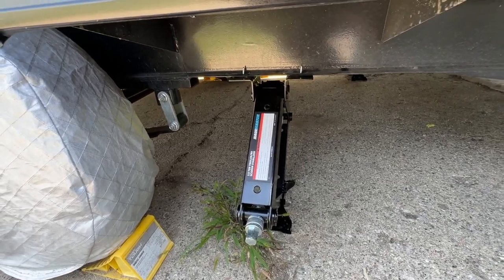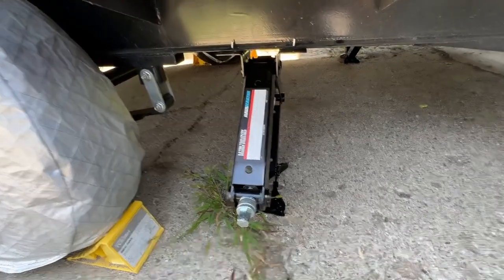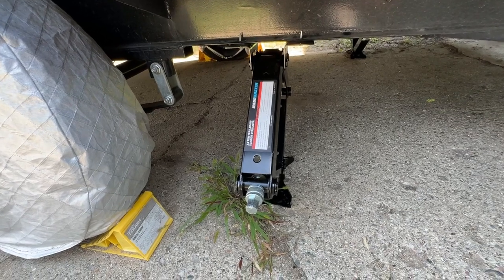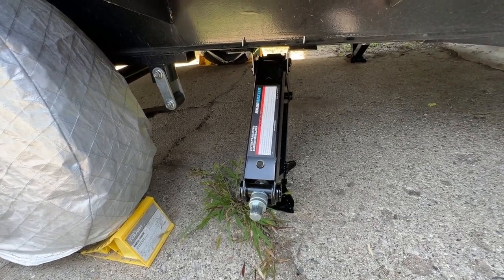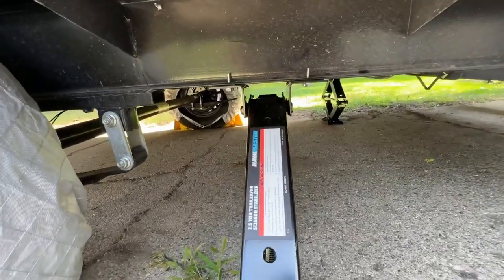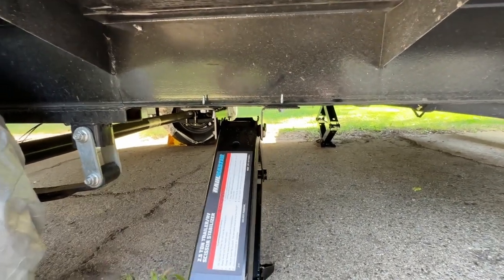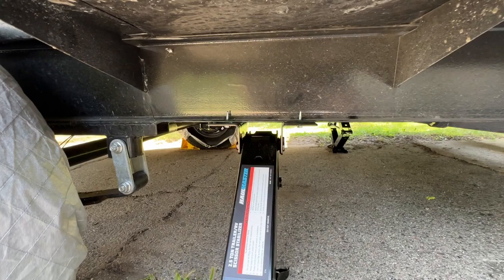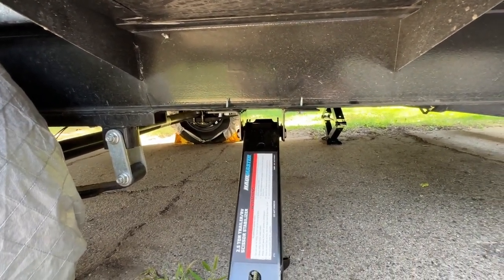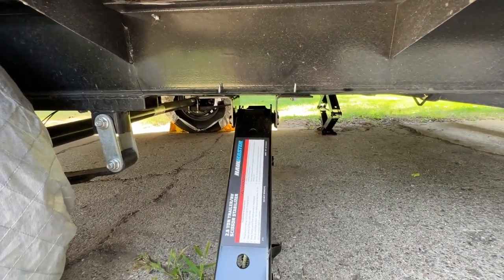I was able to test it out here just by getting inside my trailer and I was able to notice the difference quite a bit. So if you're interested in replacing your factory stabilizers, the only thing you'll need are the self-tapping screws. I used washers, so you could pick up some washers. And you will need a drill bit, because these do not line up with the factory holes. In taking off the factory stabilizers there are four holes, but these did not line up, so you'll need a drill bit as a starter, and then the self-tapping screws will go the rest of the way in.